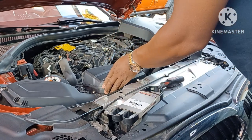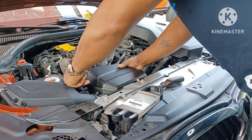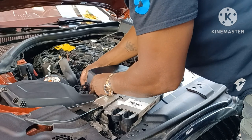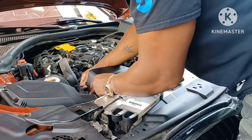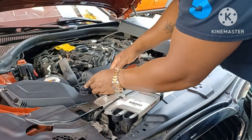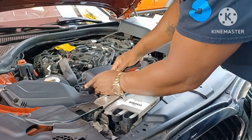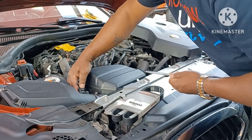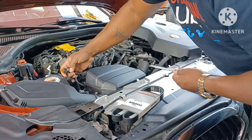Make sure you undo the wiring harness that's connected to it — you can pop it off. There's a little piece on the side you can pop off, or you can unsnap it. Push this little snap off and back that off a little bit so it allows you to push the clamp down and pull it out.